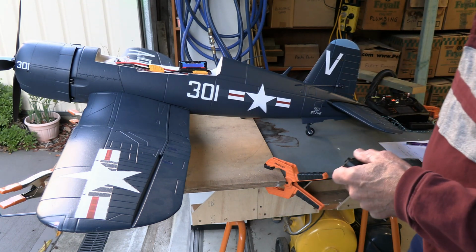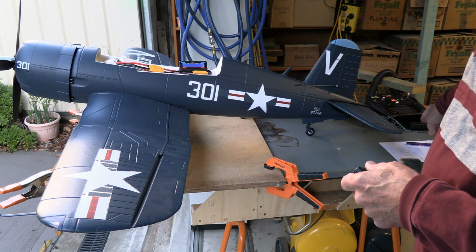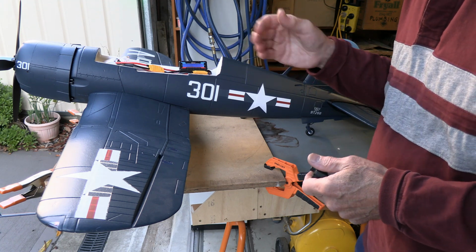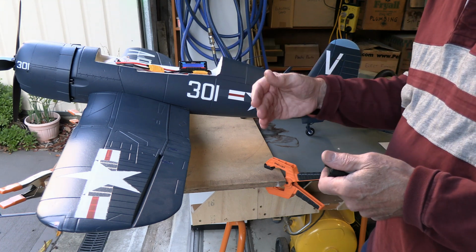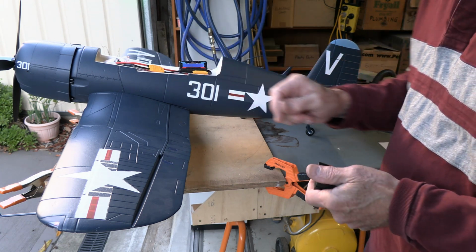the next thing to note with my meter that I've got, for measuring the force spec here, this thing locks the value when the value steadies. So you don't want to go up part way and stop on the throttle and then go the rest of the way, because it will have locked in the lower value. You want to steadily go right up to the maximum value.